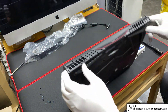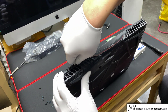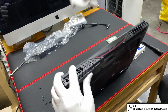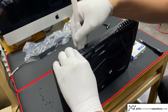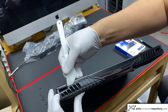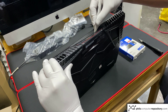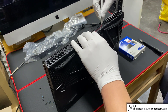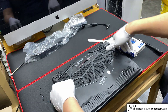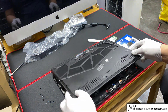Now the tricky bit is the top. This is actually where you could break the clips holding the back plate. So I'm going to get at it from the top left, insert my wedge, and just slide down. The seam is not a straight line — you have to actually look at the curves. Put the wedge down and pull from the corner slightly. You can see it's giving way. Just keep going gently to undo the clips — you don't have to force it. Slide down to the top, and there we go. From here, just lay it flat and pull, and there we go — fantastic!